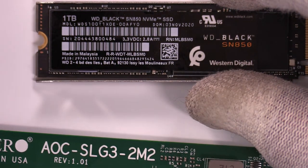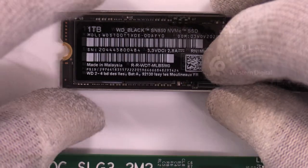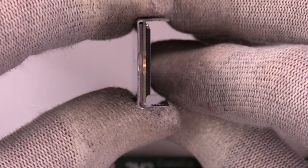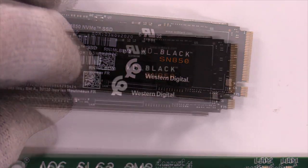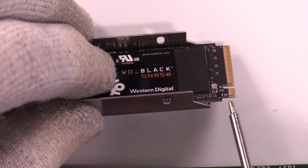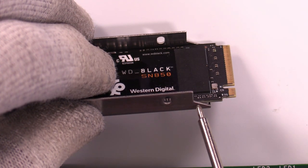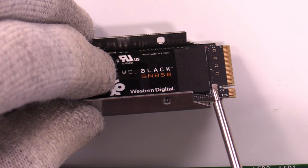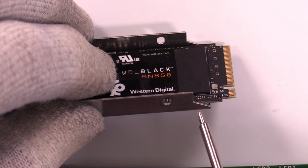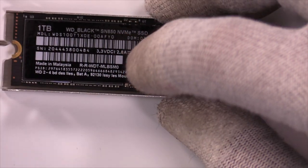And I think that's why they allowed for the bushing in the package, to accommodate this offset, which would be that thickness that we're dealing with. We'll see, but I'm aware of it. And because of the way this is machined, we can look here. We clear the connector, which goes to this edge on the far right, and this comes all the way back. So this is a good dimension, and we're also going to be on top of the controller for the thermal pad. And on the left side, that notch has got to clear that memory.